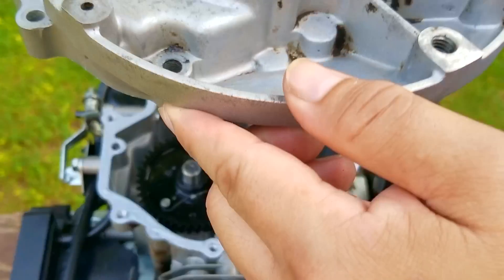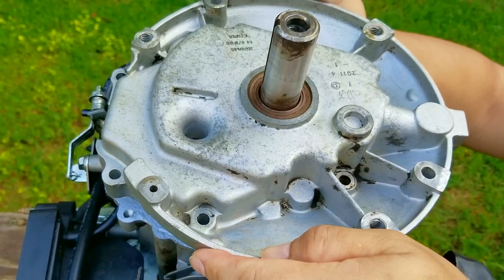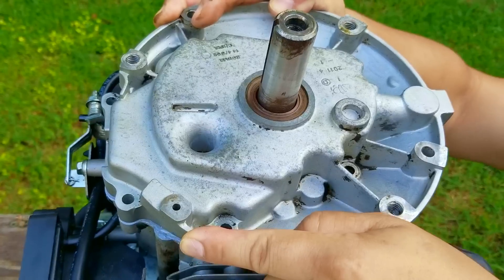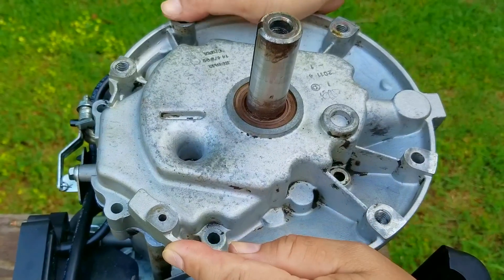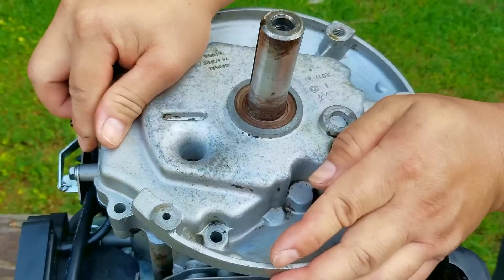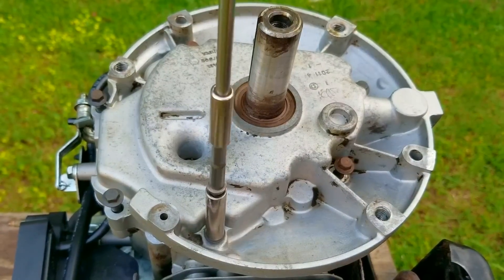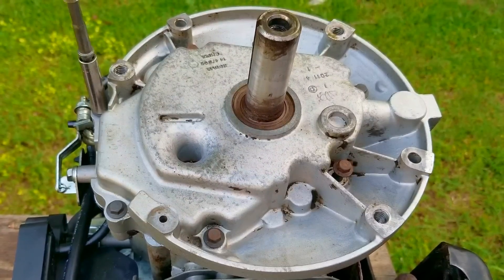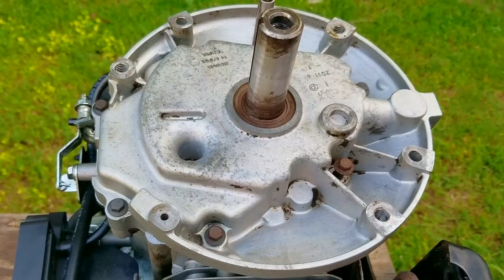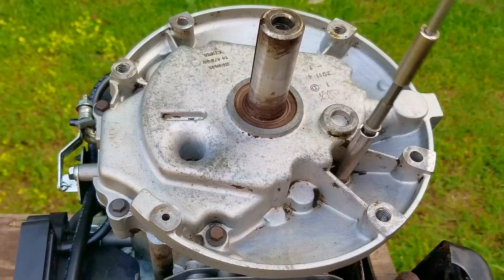I also cleaned off as much rust from the shaft as I could to make installation easier than when we took it apart. If you want, you can also put some oil on the shaft to avoid damaging the oil seal on the sump. If you wanted to replace the oil seal this would have been a great time — our seal wasn't leaking so I'm going to reuse it. Once the sump is sitting flush with the block I'll start the bolts by hand. Make sure you do not have a gap between the two mating surfaces, because that means something is not lined up.